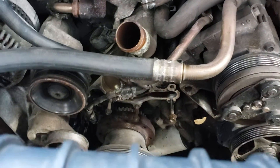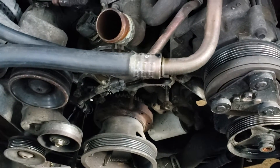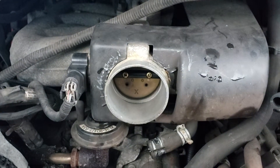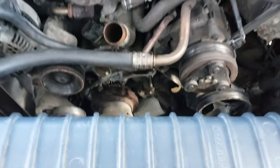Just be careful of this little harness over here — it wraps around the water pump and basically goes to the crank sensor on the bottom. Other than that, that's it. And don't forget — clean that water plate while you're here, because you don't want to have to take all this stuff back apart again. All right, ciao.